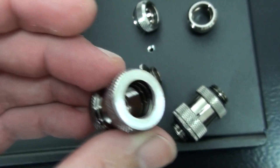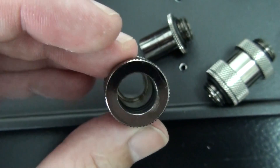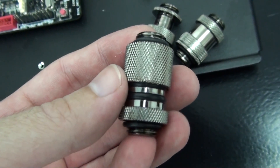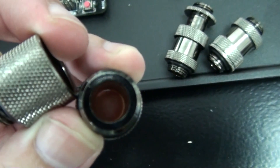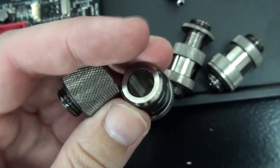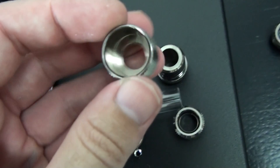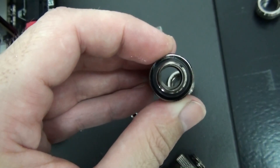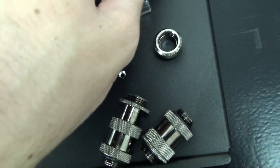The design is very simple and also very strong — there are actually three O-rings inside of this fitting, so there's very little chance of it failing and leaking, and you can dismantle it to replace the O-rings. My favorite option is the Bitspower Deplug — it's actually a quick disconnect, not a no-spill quick disconnect. There's a one-inch version and a mini version, and the mini version fits perfectly in a one-slot width between graphics cards, giving you just the one length — it's not adjustable. But the best thing about this fitting is the aesthetics: most multi-GPU water cooling fittings have a very small external diameter, whereas this fitting has a large external diameter. In a parallel configuration between multiple graphics cards, this fitting looks amazing and you really don't see many people using it.